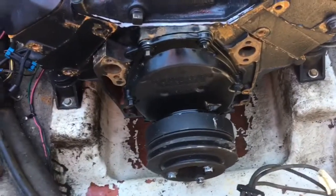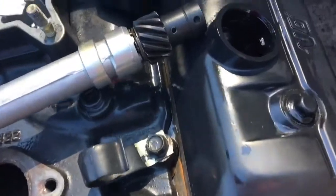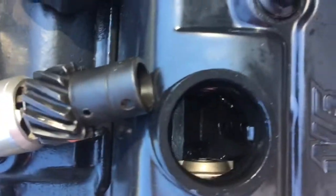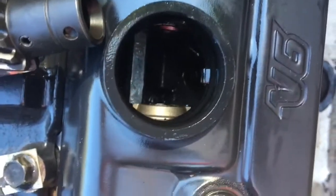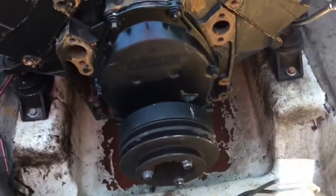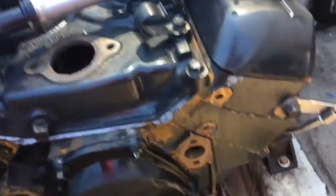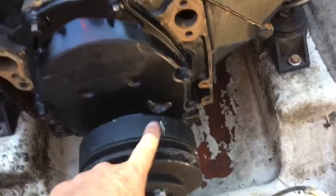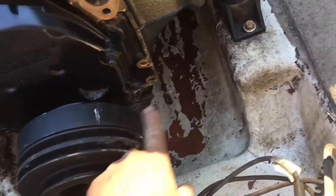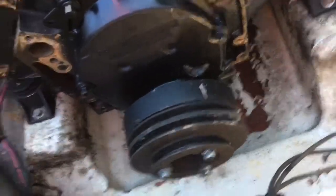This engine, and I got kind of lucky, in that the number one cylinder — which is right under here — the rocker arm can be seen and felt through the oil filler hole. You can see a roller rocker; that's the intake rocker on the number one. So I took the oil cap out and as I rotated the engine by hand with a 5/8 socket on the front of the motor, I noticed the rocker was still rocking when this line was about at the mark. That told me it had just passed top dead center on the exhaust stroke.